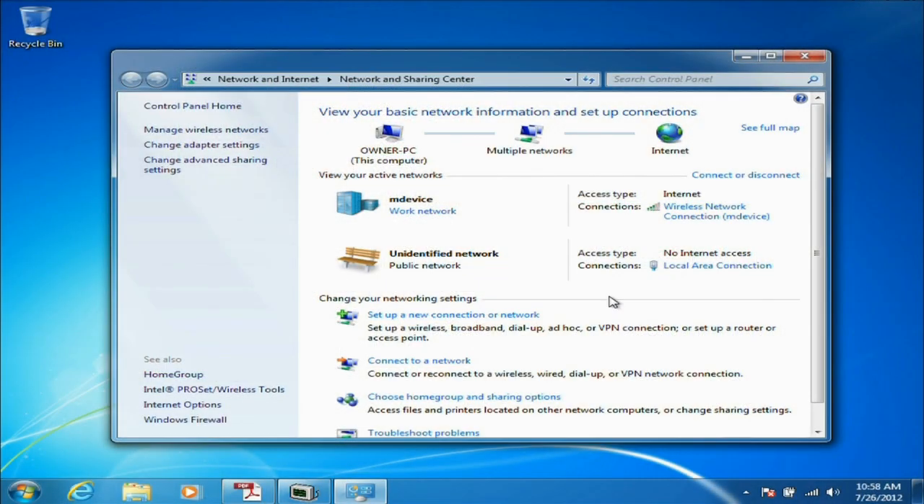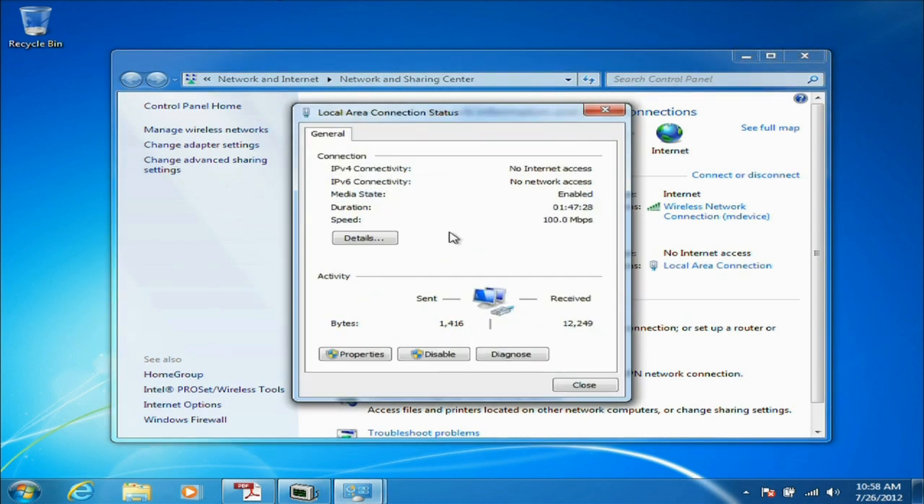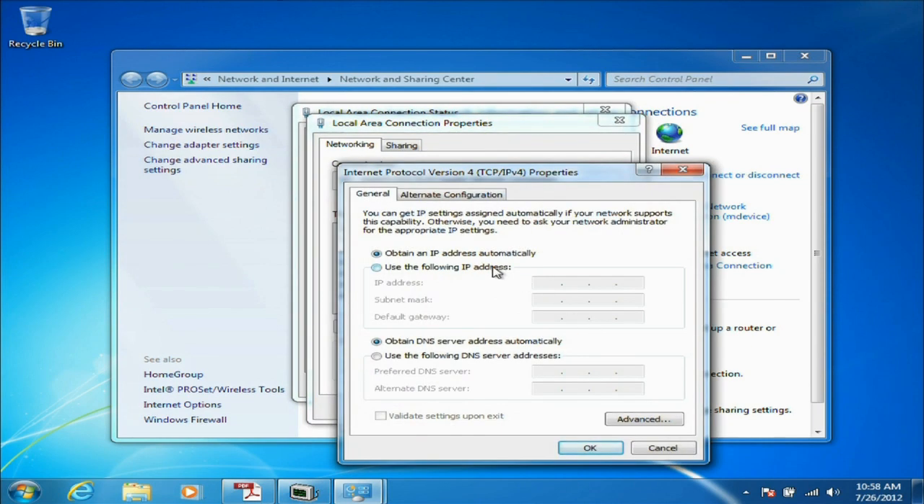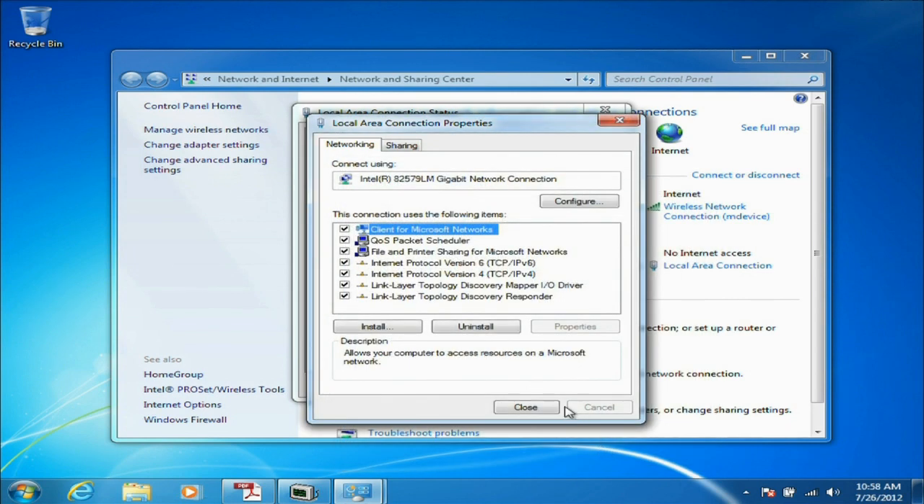Now that all phones are connected, we're going to configure everything from our laptop. The first thing we'll need to do is make sure our ethernet connection is configured correctly. Go to the network and sharing center and go to the properties of our network connection, then change the IPv4 address. For the default demo system this needs to be 192.168.42.2 — that's very important. Make sure the gateway is the 42.1 address, and because this is Windows 7 we really need to have a DNS server set to the IP Office so that everything comes up the way we need it to.